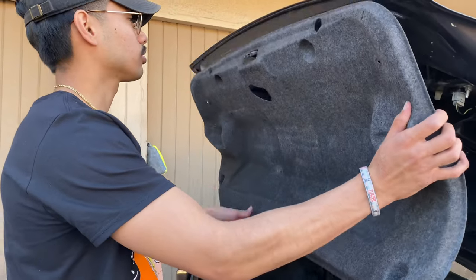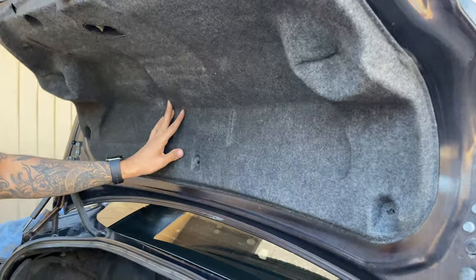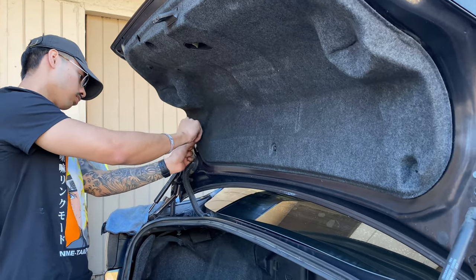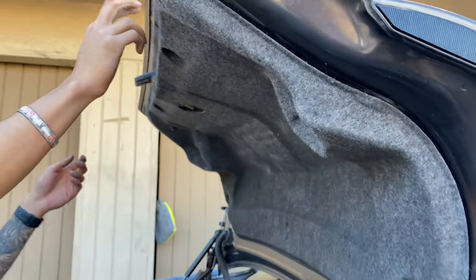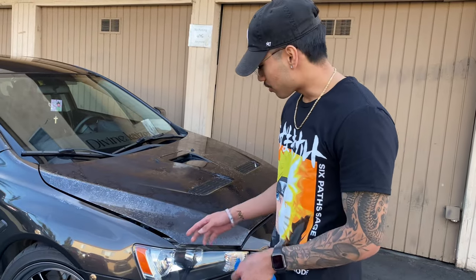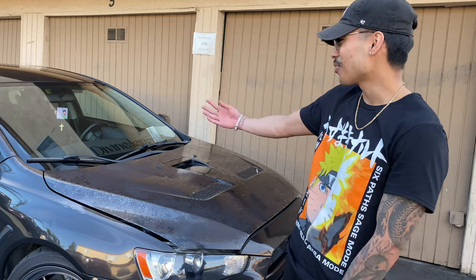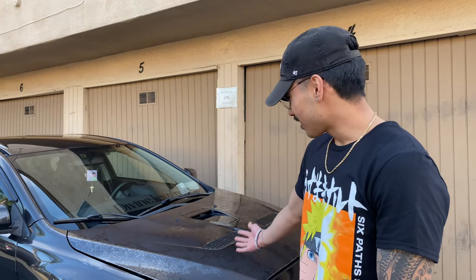Put all this back and do the same thing in reverse. Right now we're about to tape off the edges of the car before we start wet sanding — make sure to cover up the vents too because it throws up the water. I'm gonna tape that up, wet sand it, come back, dry it off with a water and alcohol mix, then wet sand it, buff it, polish it, wax it, and hopefully it comes out good. Like I said, this is not a permanent fix — it's very temporary — but anything is better than it looking like this right now.